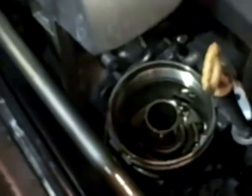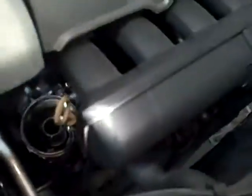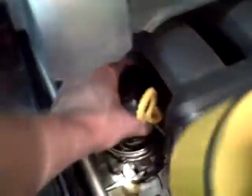So you can see right there, that's where my oil filter goes back in. I got my new oil filter right here in the housing with the new O-ring. And so now I'm going to work on putting this guy back in there. And we're just going to screw it in. Our new wrench to tighten her down. All right, back in a second. Okay, so I'm gonna go back in, tighten this guy up. Obviously don't want to tighten it too much, but enough so that we're not gonna spray oil everywhere. Yep, that is good. One more. Perfect. All right, we should be good to go.